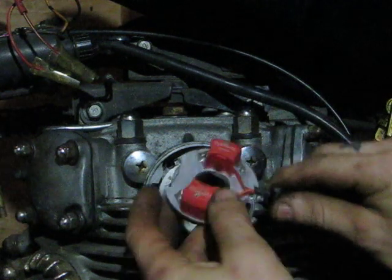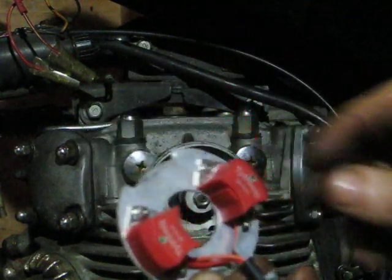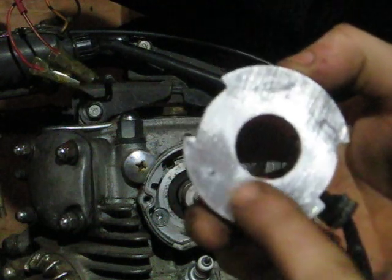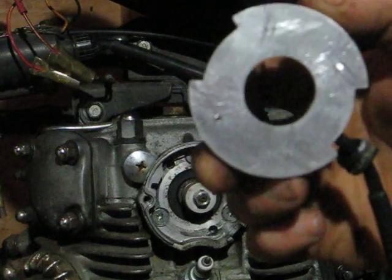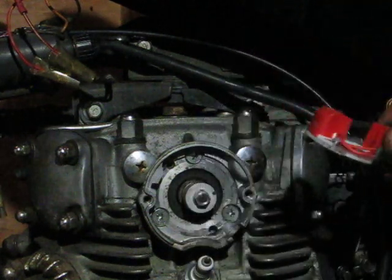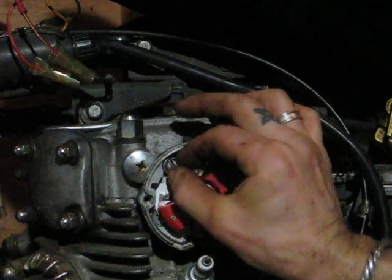Take your Tytronics plate. So the 4 bolts that hold down these triggers, they're not tight when you get it. You want to snug them up just a little bit, and then they all protrude out the back a slight bit. So I hit them all with a buzz wheel. You could do it with a file, pretty much anything. And then I just put a piece of sandpaper on a piece of glass and gave this a little rubby rub. Give it a nice flat surface back there. It's not necessary. The first time I installed it with those bolts there. Since there's 4 of them, it's a decent footprint to keep it sitting flat and level.